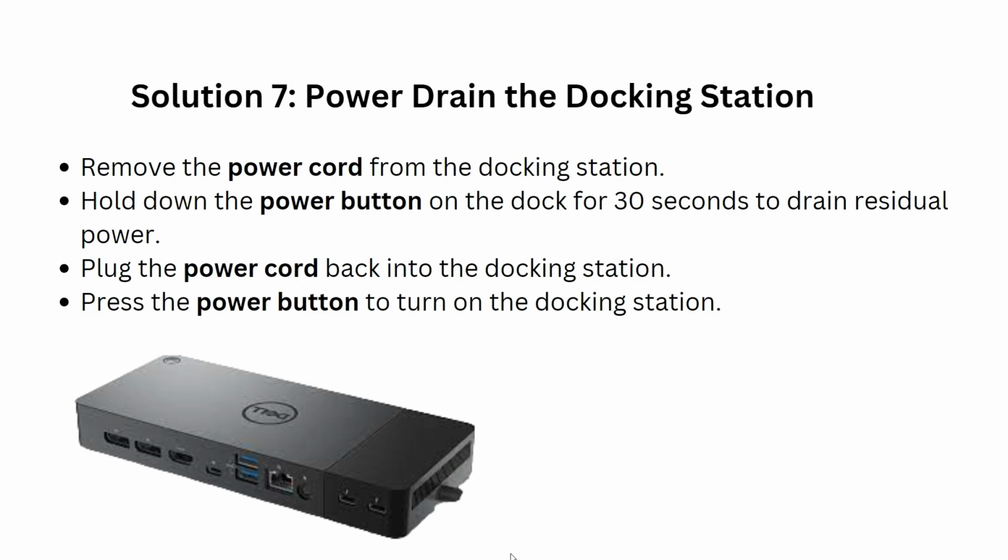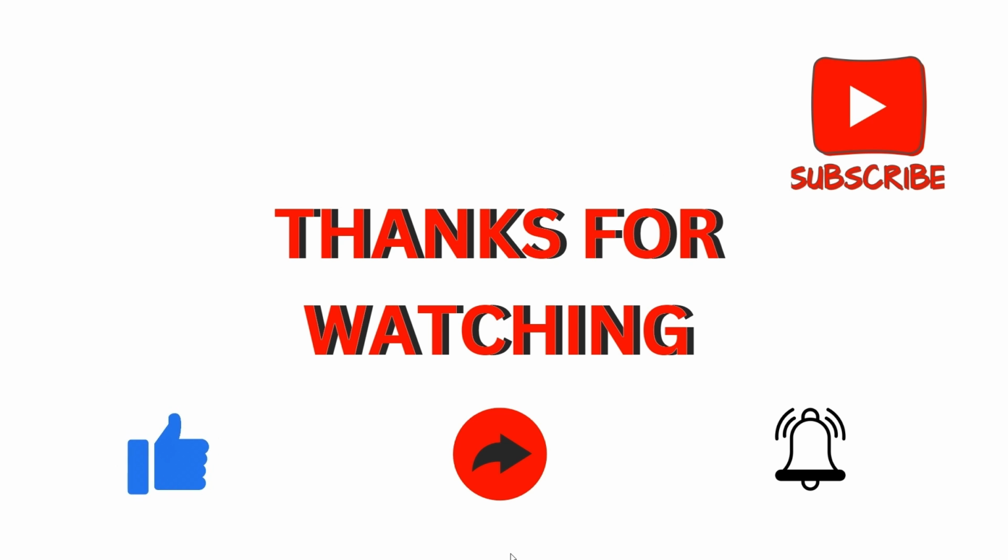And solution 7, power drain the docking station. Remove the power cord from the docking station and hold down the power button on the dock for 30 seconds to drain residual power. Then plug the power cord back into the docking station and press the power button to turn on the docking station. So these are the solutions you can take when you tackle the problem of the docking station not detecting a monitor.